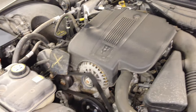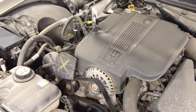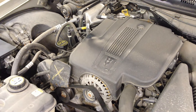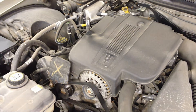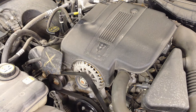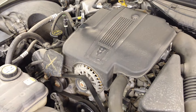If you're driving only 500 to 1,000 miles and it's all short two-mile trips within your three-month period for an oil change, you really should still change the oil. All those acids are produced because you're driving short trips and you've got water mixing with the oil — you're actually doing more damage by doing those short trips and not changing your oil. So even at 1,200 miles in three months, you should still change the oil because that oil is basically unusable and acidic. The new oils nowadays are more resistant to that, but it still happens and it's still a good practice.